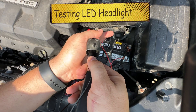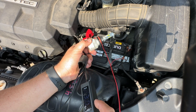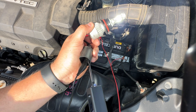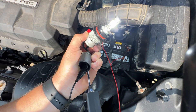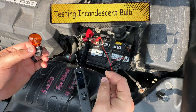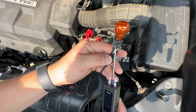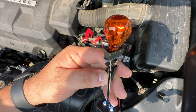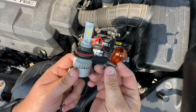I'm going to go ahead and test this light right here. I'm going to put the negative on and then come in on this side and push the upside, and you can see right there that light is good. This does have a little fan in it too — you can definitely feel it in your hand. So this tests your light to make sure it's good — that's an LED headlight that is good. As soon as you take it off, it turns off. You can also do it on traditional bulbs as well. It does light up — it is pretty bright outside, but as soon as I remove it, it comes off and it is reading 12 volts. So you can do it with old school bulbs or even the new LED style to test your bulbs. If you have a bulb issue or a wiring issue, this is great.